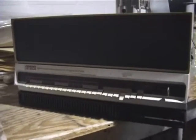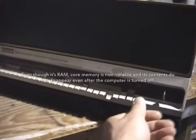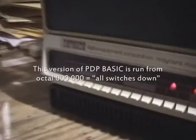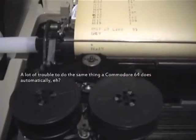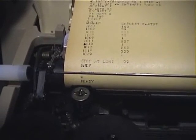Here's one last little thing I'd like to show everybody. We've got the computer completely off. I'm going to turn it on and recall BASIC that is stored in memory. I'm going to turn the computer on, and then I'm going to turn the teletype on. I have the switch registers set to all zeros. I'm going to load that address in memory, enable the computer, and push start. We look over at the computer and you can see we have a ready prompt, which means I don't have to load it from paper tape every time I want to use BASIC on my PDP-1105. The great thing about core memory.